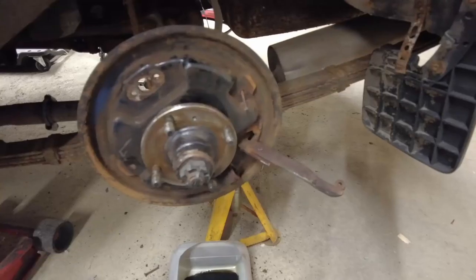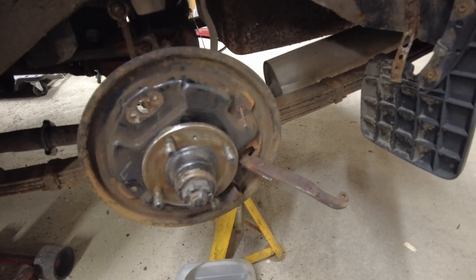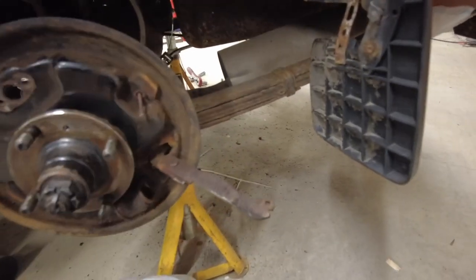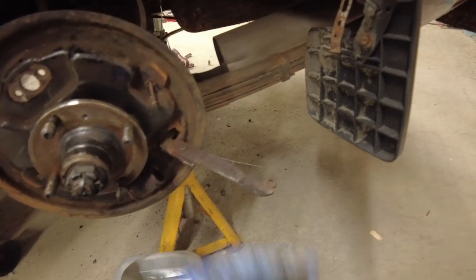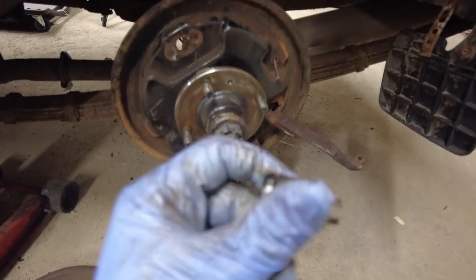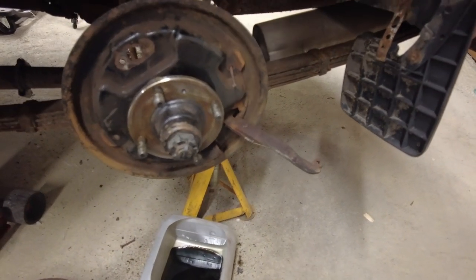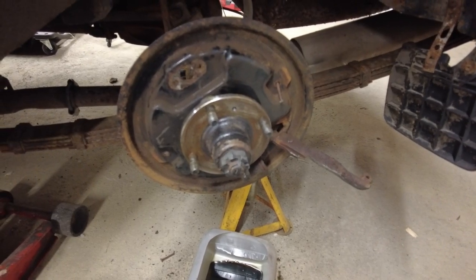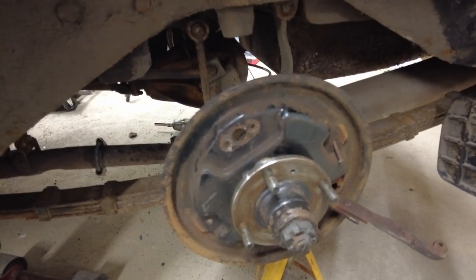Unfortunately we've come across a bit of a snag. I've stripped down the drum on this side and everything looks good, but when I opened up the slave cylinder that's the kind of crap that's going on inside there. I don't think that's going to pass. I took the pistons out - there's one of them, and the other one is not much better. Realistically I need a new set of slave cylinders. I could try and clean them up but I just don't think that's the right way to go about it. The adjusters on this side were seized as well, so that certainly needed to be done.